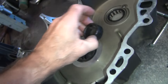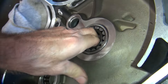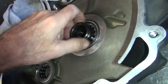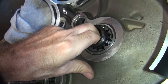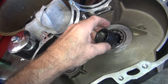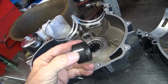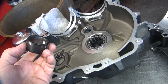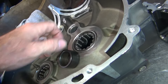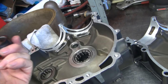These things are too big in diameter. This one's even tighter - hear it coming out? That's tight. That's supposed to be a nice loose fit. Now on a street bike you can kind of get away with this a little bit, but tight bearings do not live very long - they're not happy. These are really big bearings so they can take a lot of abuse, they can tolerate this a little bit. But not when you're racing it.